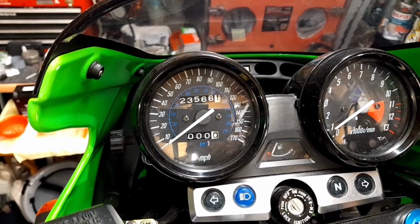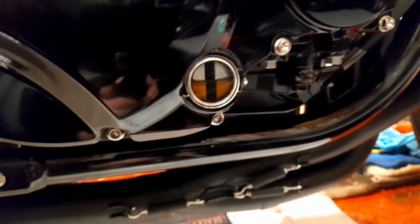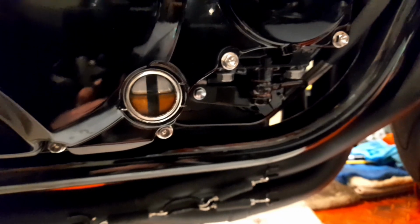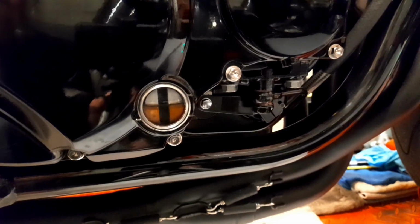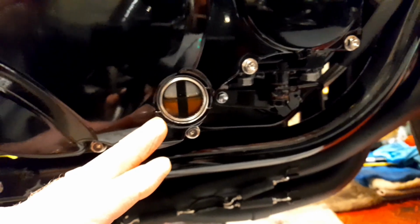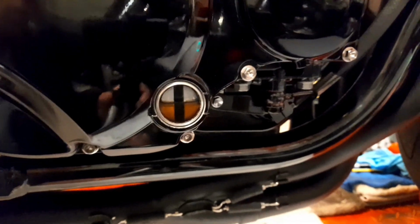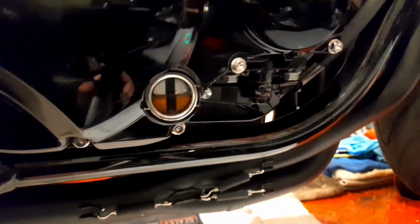Okay guys, let's just check to see what this sight glass looks like. Well, there it is. It's just below the full mark, as you can see there. But normally, whenever you would be at the oil level for these bikes, running a ZZR 1200 clutch cover and the sight glass, that's normally where I would have the oil level anyway. You wouldn't have it right to the full mark like you would do if it was a ZRX. Just a bit below it there. So that's spot on.